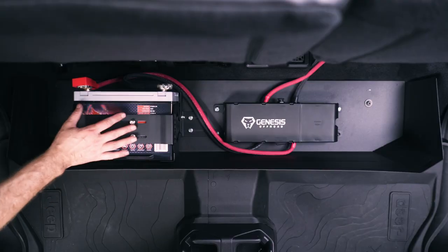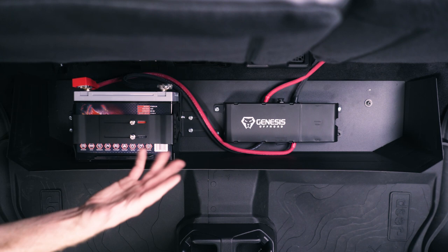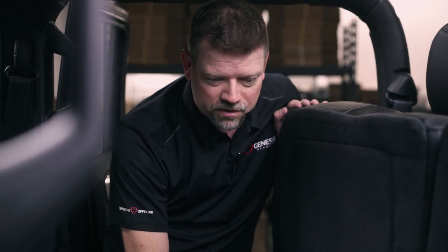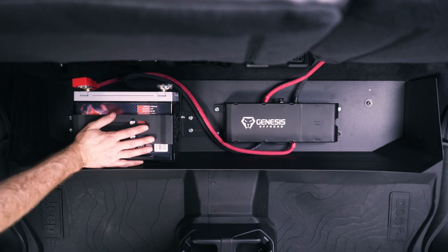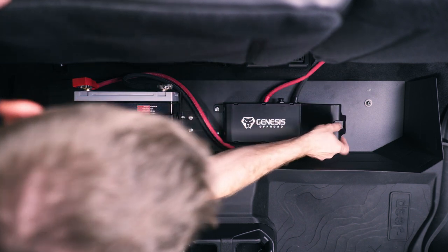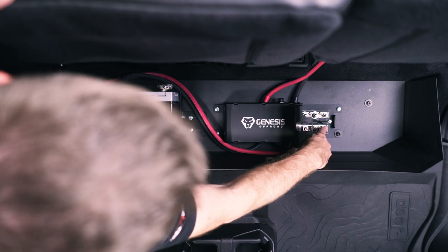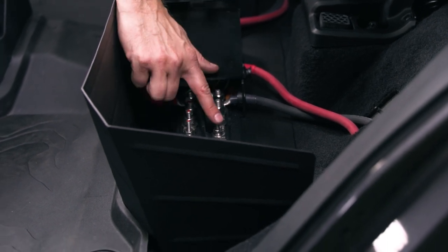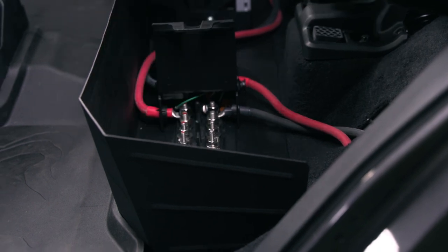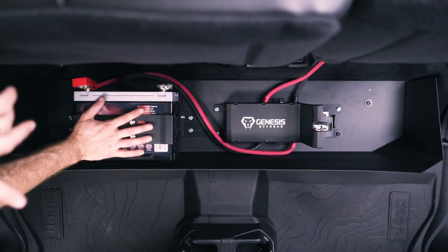So that's all under the hood. This should be your last connection that you make because we don't want that wire being hot under the back seat. Now that everything's done, let's go back and wrap up. So that's our dual battery system for the Diesel Gladiator. I know we're using some of the space under the back seat that you might be using for tool bags, air compressors, or other gear — but we really have no other option. This is the only spot on this vehicle to put the batteries safely and out of the way. You still have room over on the driver's side to mount some other accessories. If you're ready to hook up accessory wires, just route them inside the vehicle and under the carpet to our bus bars. Your positive wires will go on any of these three studs here, and you also have a couple of small terminals for smaller gauge wires. Your ground connection is going to go over here. Anything you wire up there will run from your accessory battery and not drain down your cranking battery.